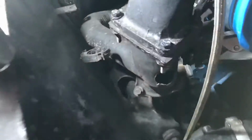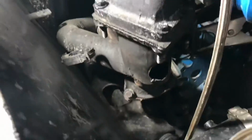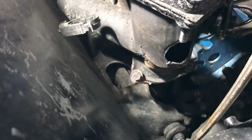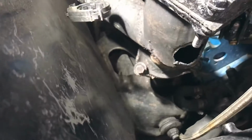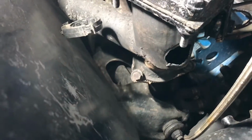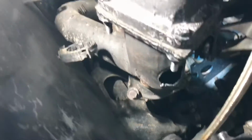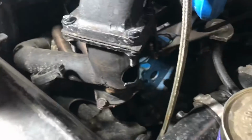I know it's kind of hard to watch, plasma cutter going inside the exhaust right before the turbo, but I got a magnet put down in the merge down there, down in through this pipe here, and got out what I could, and then started the truck 4 or 5 times, and whatever was in there, it must have blown out, because I put the magnet in again and there's not even any filings or anything sticking to it, so I'm fairly certain there's nothing left in there.